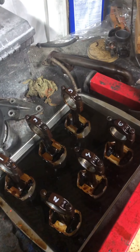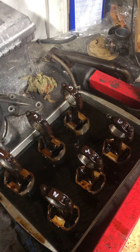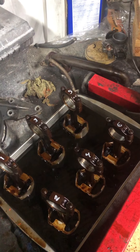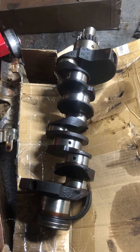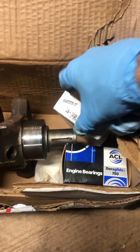People were influencing me — they said since I already had it torn apart, why not do a stroker kit? I asked how, and they said just buy a 3.1 crank. The 2.8 and 3.1 rods are the exact same size. What happens is you get bigger journals on the 3.1 crank. Here's my stock 2.8 iron block crank, and this one here is the 3.1 — you can see the journals are definitely bigger, and it already came with the bearings needed.